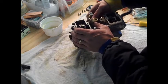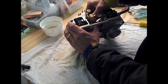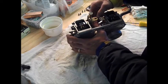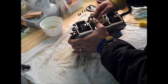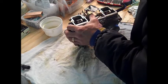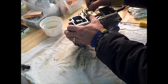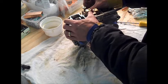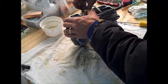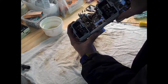The next step requires you to rotate the throttle cam all the way back. You could sit and hold it with your hand while you work, but that makes it nearly impossible. What I do is push it back and jam a screw into the cam screw head to hold it open. Put the tip of the screw into the cam screw head and jam it so it stays all the way open — it just works out just right.